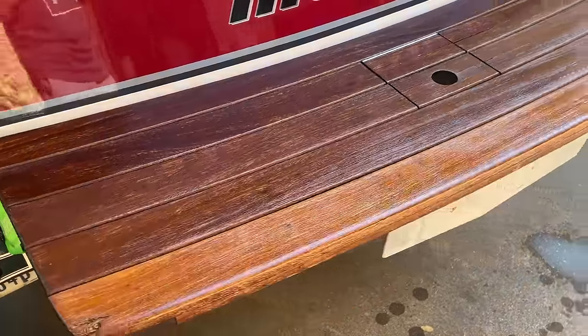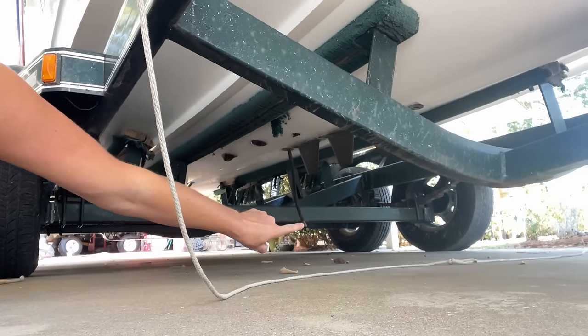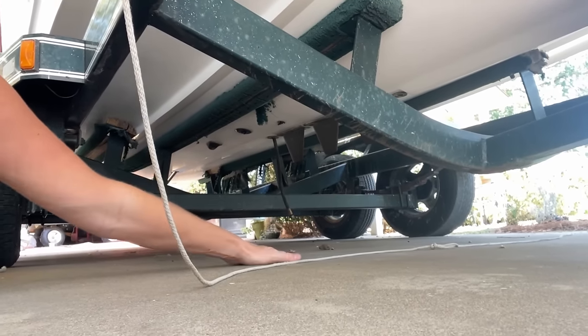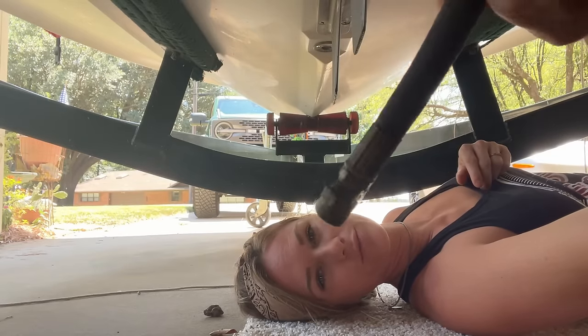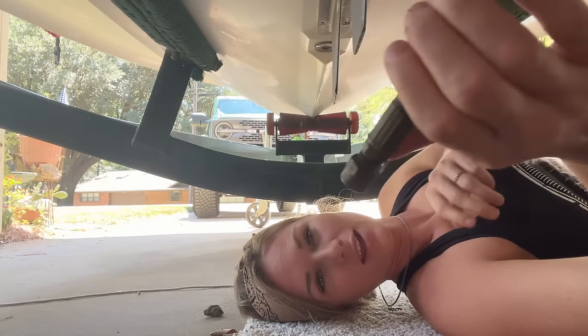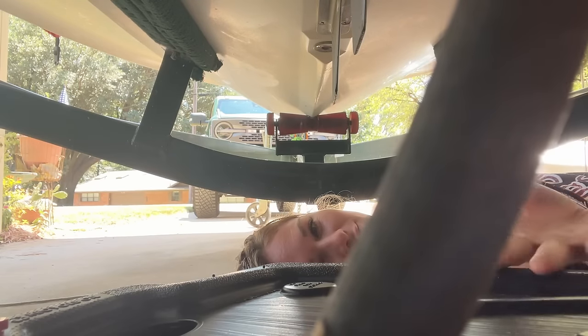One of the things we need to check off the list is an oil change. I've already stuck the little hose down through the drain hole — the hose drops down right here out of the bottom of the boat. I'll put my drain pan right down there, and I've got a piece of carpet that I'm going to lay on to take the little cap off and begin draining the oil. I've got a couple of crescent wrenches and I'm going to take that cap off.